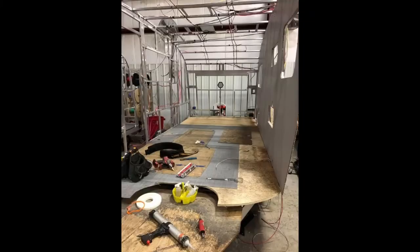When talking about the In-Tech Terra or Sole lines, the construction is a full aluminum frame and aluminum structure, and everything is attached to that. As you can see in this picture — this happens to be an In-Tech Sole Horizon — all that wiring is put in at the factory, drilled through the frame with grommets at every position so there's no chafing against the wires.